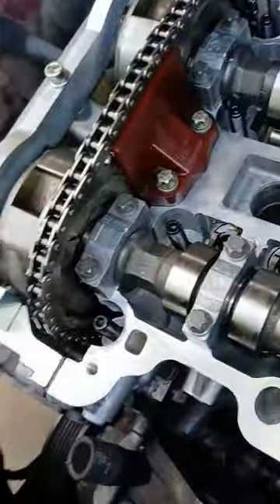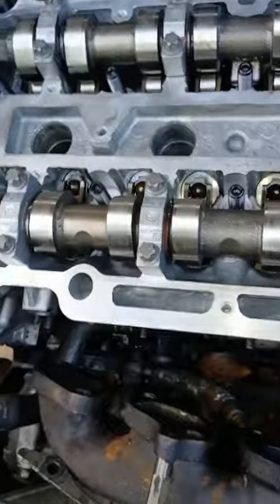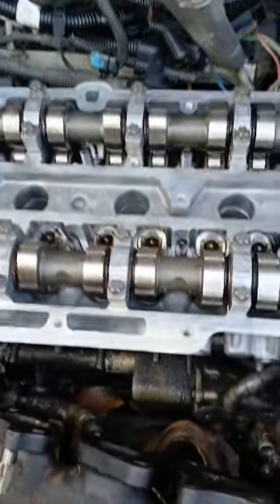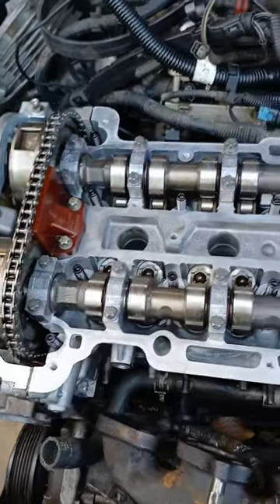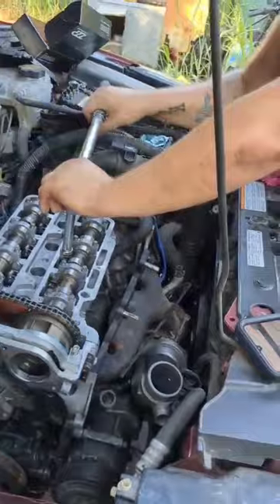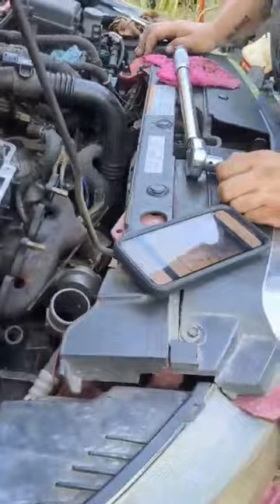All right, we put the ARP studs in here. I still got to tighten them up, gotta go find my torque wrench and all that, but it looks nice and clean. Got everything on here — nothing's torqued down yet, we just now set the head back on there with the head gasket. I'm putting in the ARP head studs — I'll just call them ARP; they're ZZP which is made by ARP. I'm not sure if ZZP is a little less quality, but they were still over 100 bucks for a four-banger. Torquing off to 60 foot-pounds — almost done.